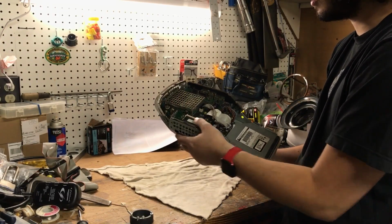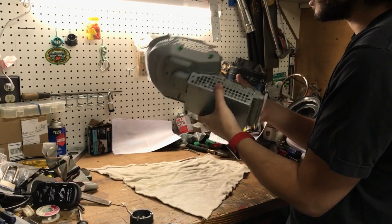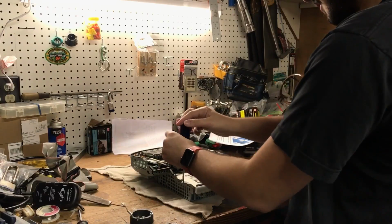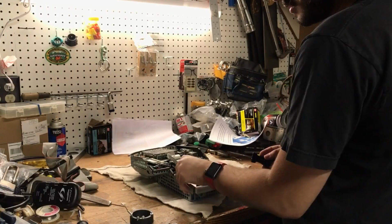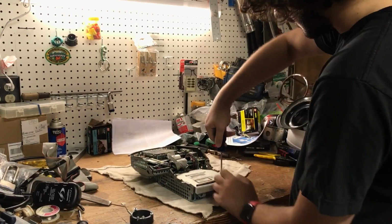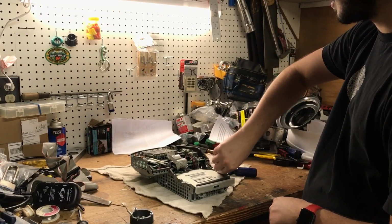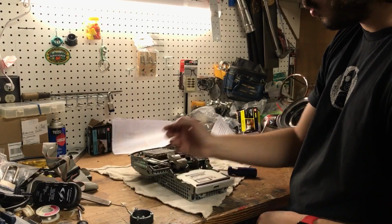And if I can get Mac OS X to install on it, I'll actually be able to see more details in the About This Mac section, because, well, the About This Mac section in Mac OS 8 just kind of sucked. Alright, so the next thing to come out is the CD drive itself. It's held in by this little bracket with 2 screws, and it's spring-loaded, which is interesting, and I almost stripped out the screw there. On a 20-year-old piece of hardware, the last thing you want to do is strip out the screws, because chances are nothing else is going to fit, especially if it's an Apple product.